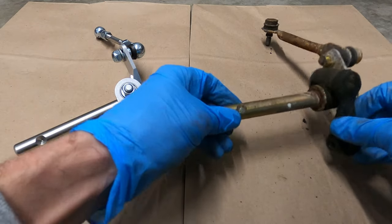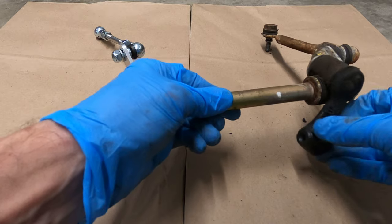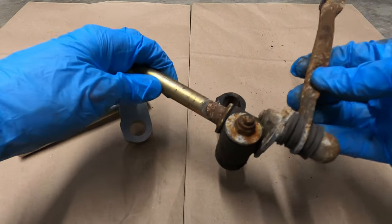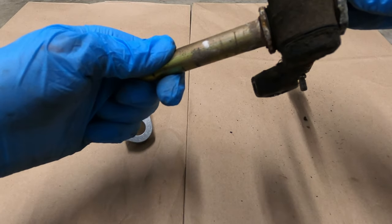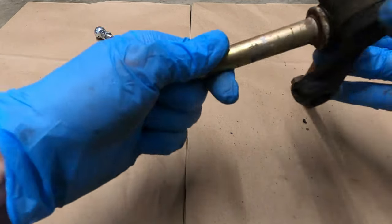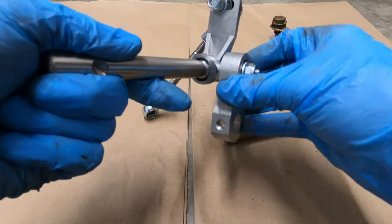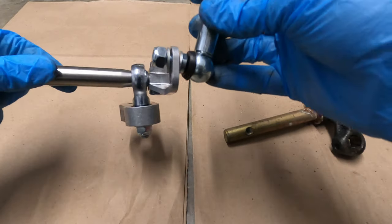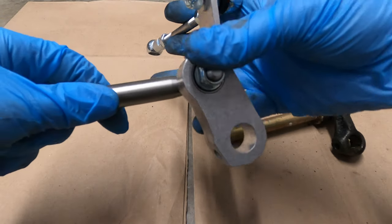Here's a look at the two parts side by side. You can see the factory shifter features a couple of pivot joints stacked on top of each other, and I suspect that some of the play is coming from this linkage. The new one has a heim joint and some ball joints on the linkage, which should eliminate some of that excess movement in the shift handle.